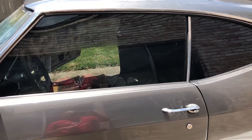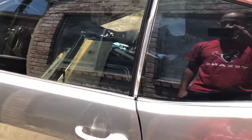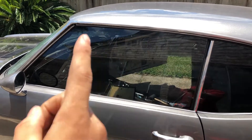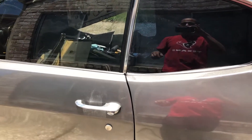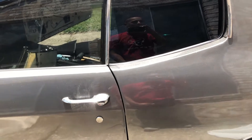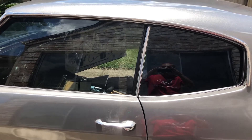You also have to make sure that opening and closing the door can be done without an issue — you don't want to have to throw the door in to get a proper fit. When lining the windows, remember there are three directions: up and down, side to side, and in and out. I'm using all aftermarket parts — the window felt, window seals, and weather stripping — and you don't need original parts to get it exactly right.